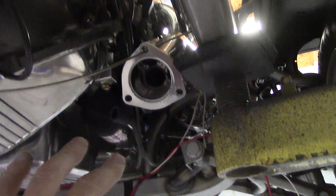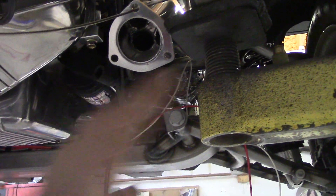He's fitting the starter — obviously the headers are on the engine. He's got cutouts that have to go on there, so we've got to fit those in. He's running the wires, just roughed in right now. This is all going to come apart because everything has to be painted under here. You can see he's hooking up the steering, figuring out where the steering shafts go — that's turning out really nice, working out good.